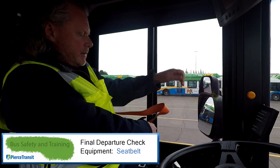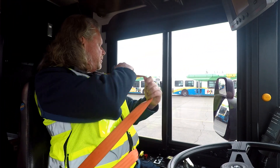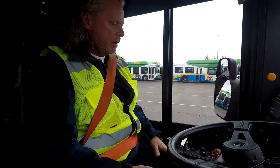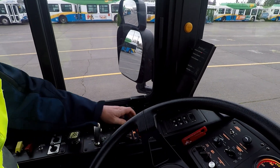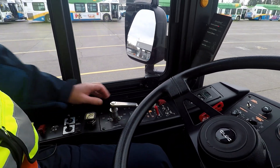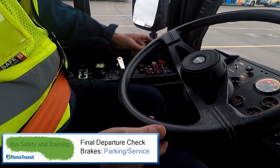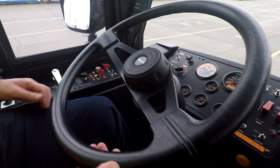A couple of last checks as we're leaving. Make sure our seat belt is adjusted properly and latches securely — it does. There's a little too much play, so I can adjust that by taking this out a little. Close our front door. We're going to do a check of our rear door interlock — open the doors, put it in gear. I want to open the rear door, which engages the interlock. I release my parking brake, ease off the brake, and try to give it some acceleration — I have a dead pedal. That means our interlock is working properly. Close our door, set the parking brake, and give it some gentle acceleration, pulling against the parking brake to make sure it holds the vehicle. And it does — parking brake is working properly.